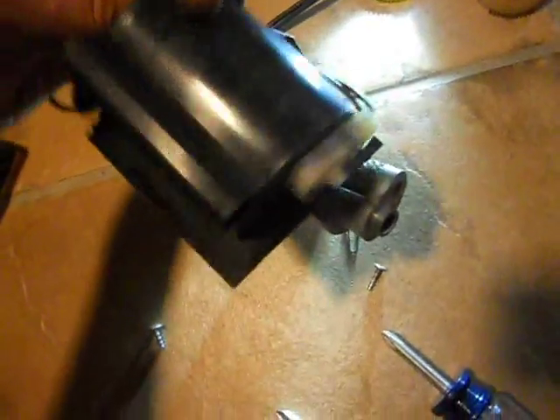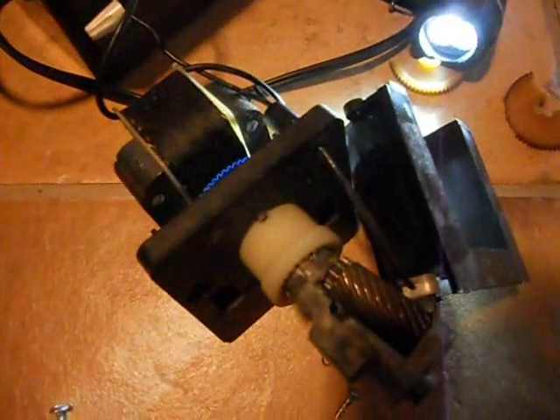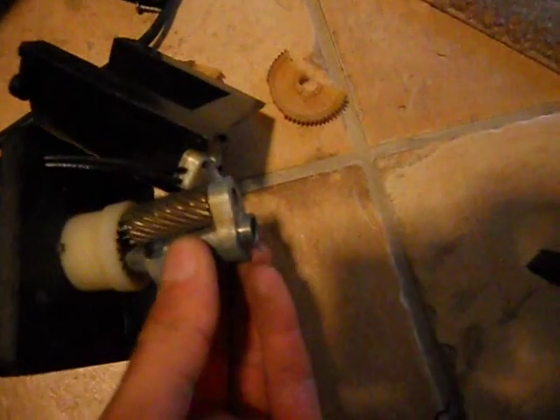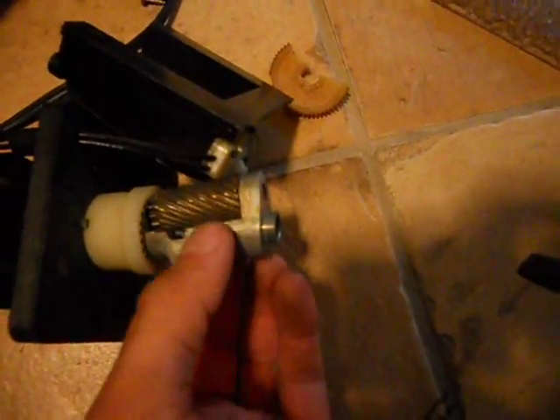I was able to sneak the old gear out, but to put the new gear in I had to take a little plastic cover off — just two more little screws. I pulled back the sharpening piece, which pulls the shaft in so you can get the gear on. You'll probably have to do that to install it. The gear's on — look at that. It pops in. Make sure it spins freely. I'll put some dry lubricant in and lubricate the motor as well.